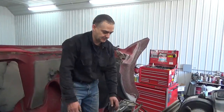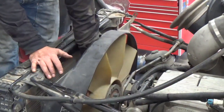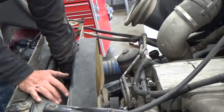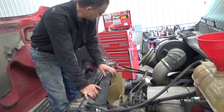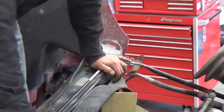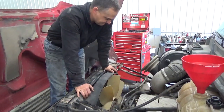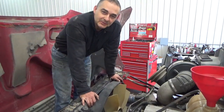We've got the fan blade on. With the shroud back, you can get your hand in there just enough to get those nuts and washers on for the fan to the hub and tighten them down. Basically what we've got left is to put the fan shroud up and bolt it up, bring the bracket up, and get that where it needs to be. We've got the antifreeze in — the job went pretty smooth. Thank you for watching the video, and have a great day.